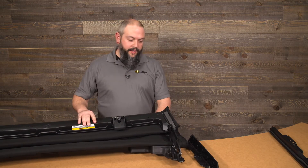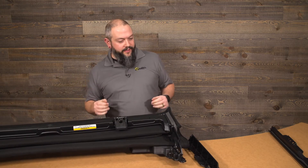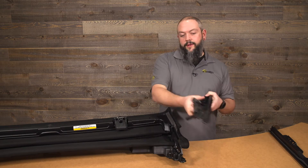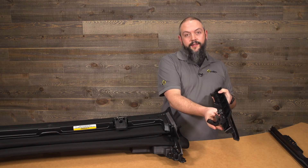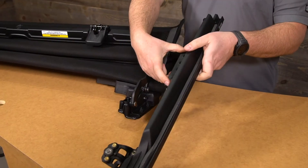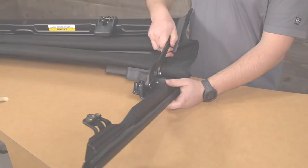The header is at the top and you can tell that it would fold forward, so the front of the Jeep is facing toward you right now. Take the door surround and note that the C-clamp with the hinged part is going to be at the front of the Jeep as well. These set of holes are going to line up with this portion of the actual Sunrider for Hardtop mechanism.